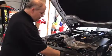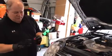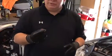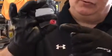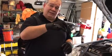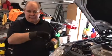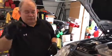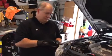Attempting to remove the valve from underneath, it looks like it was too brittle, hard already because of the time, and it broke. As you can see here, the valve to the side, it broke. So there's a whole stem all the way in that is still inside the radiator, which plugs it, right? So the radiator is still plugged. So that then is the first step. I need to remove that stem from it to be able then to drain and then ultimately put a new plug of this. Now the story.